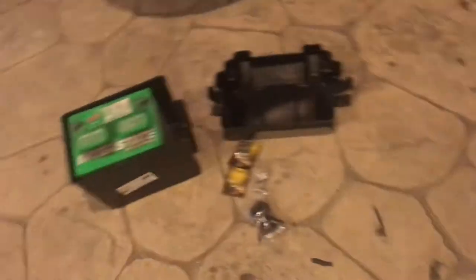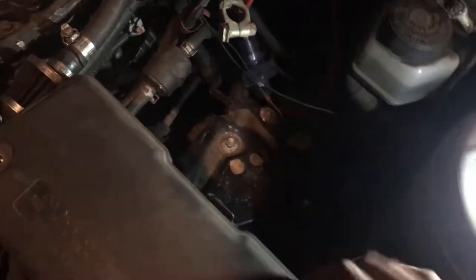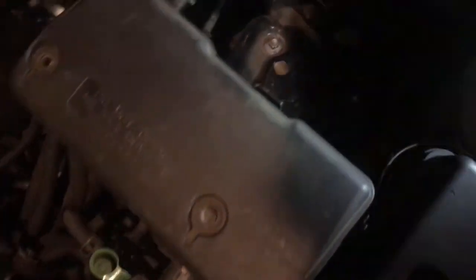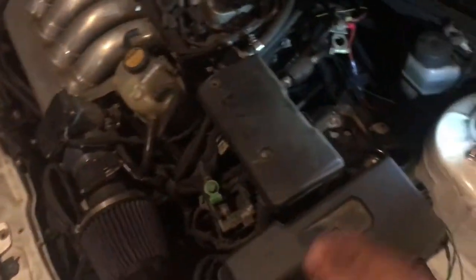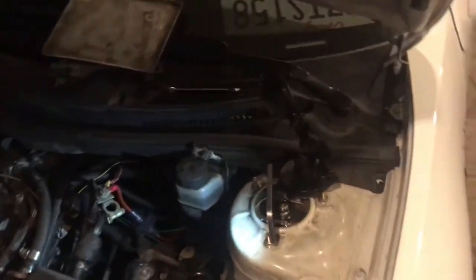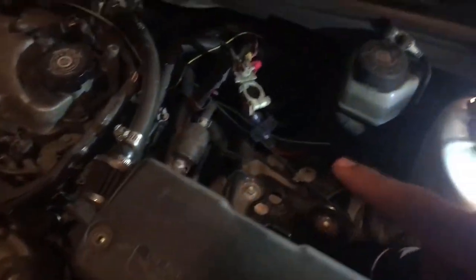Battery's out — pretty easy, just size 10 here, size 10 there, tens on the bracket, and that's it. Battery should slide out. This is just a cover, so I'm gonna end up cutting these and putting the fuse and going all the way to the back. That's gonna be the hardest part — putting that wire through the firewall.